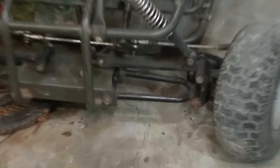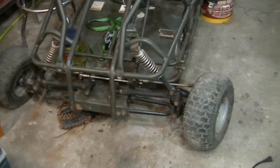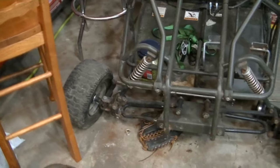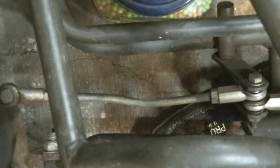Here's the front end of the go-kart. That one A-arm is perfectly fine while the other has a little bit of 'cattywompness' to it. We heated it with a torch and beat it out as best we could, but it's messing up the whole front end. We're also putting new bushings in both wheels — that one's cambered out like a 95 Civic. We'll replace the tie rods too because both are bent quite a bit.